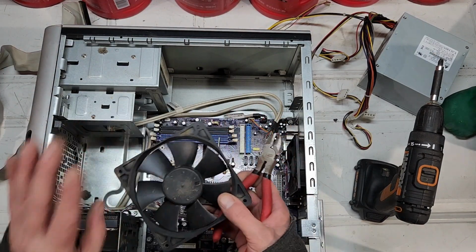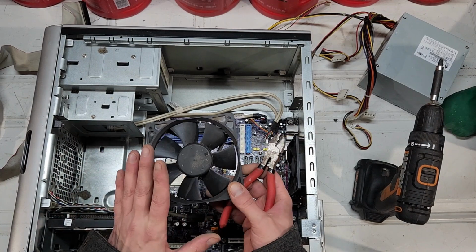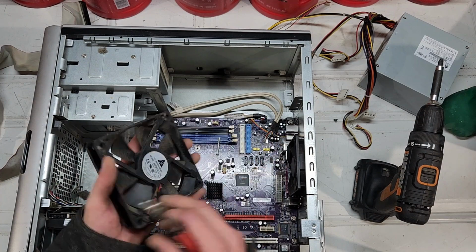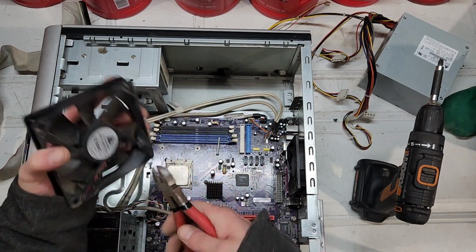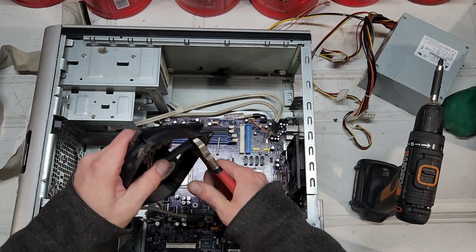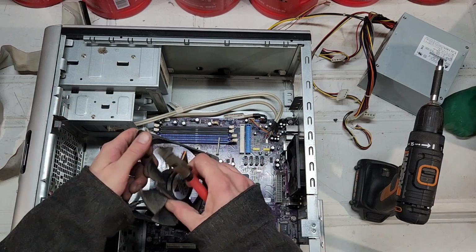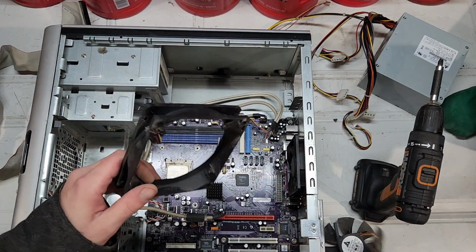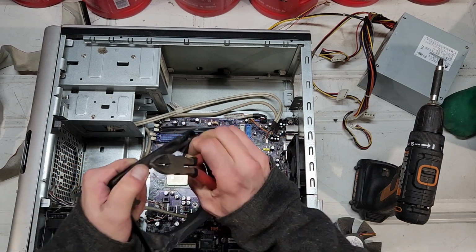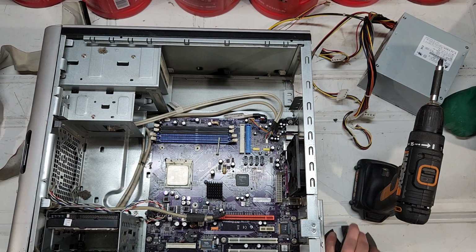What do you do with the fans? Well, the fans, you can keep them like this. Your junkyard is not going to take them like this as copper-bearing motors. They're probably going to downgrade you significantly. That's up to you. What I do is I just take my clippers and we go through and break off, and they're all built exactly the same. I mean, darn near down to the dimensions, they're built the same. So you can crack that off. Unfortunately, that's going to be a little plastic. So you go ahead and get your number 2 wire out of there. Why throw it away? More plastic, unfortunately.